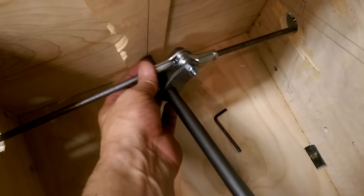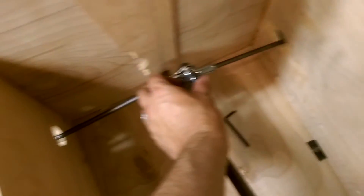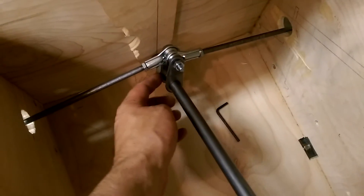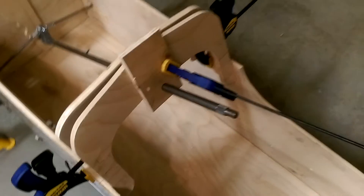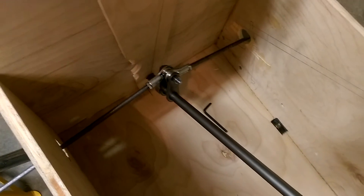At the moment it's getting bound up when I turn to the right, so I'm guessing some linkage in here has been caught somehow. I need to experiment a bit more with that, but it's looking pretty good. Once you've got this in position, you weld these pitman arms onto the steering column, and then I also need to shorten it once I know the distance.